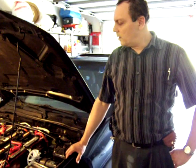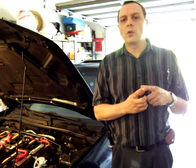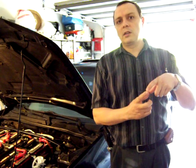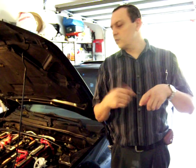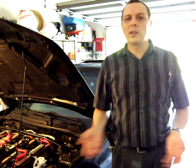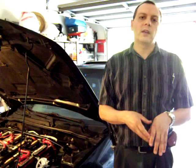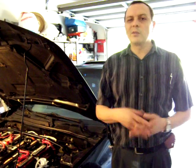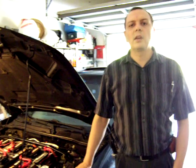There is something I'm having a problem with though — the bearing in the clutch is making some noise. For all those of you doing your conversion, make sure you change that bearing in the clutch, because it's complicated to change it if it fails after assembly. This one is making a squeaky sound; it was old and I didn't think about replacing it. Now I'll eventually have to remove the motor and put in a new bearing, but it's not a big deal so I'll keep driving with a little squeaking.